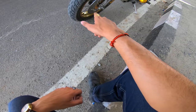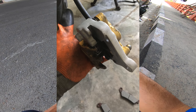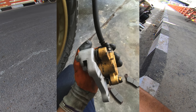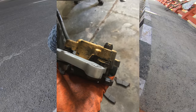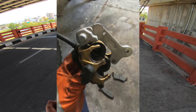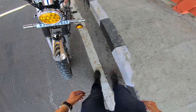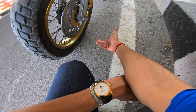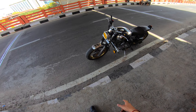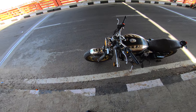I did have one issue though. This disc came oiled, and I didn't clean it enough before installing it. That oil glazed the new brake pads, so I had to open everything up again and deglaze them using sandpaper. It's also recommended that you change the rotor bolts — I didn't do that because it was a Sunday and everything was closed, but I did put in red threadlocker so they won't come loose again.